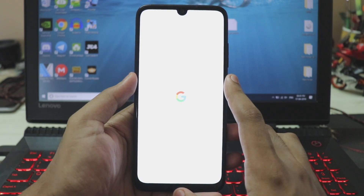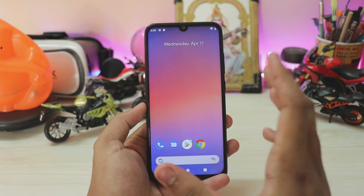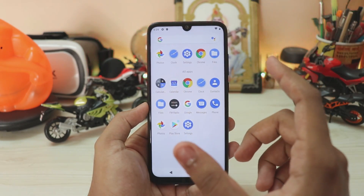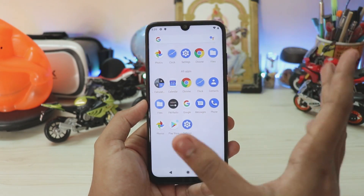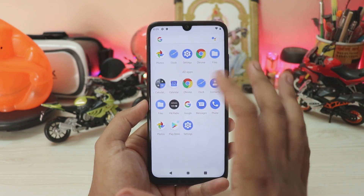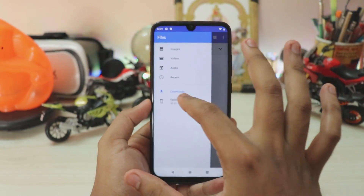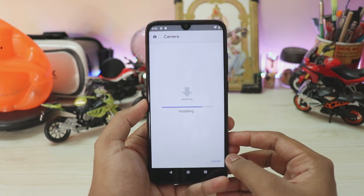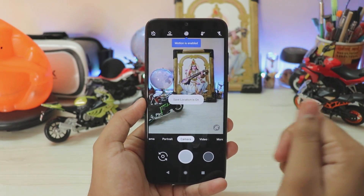The ROM has been successfully flashed with no errors. Select reboot system and there's the Google logo — the first boot will take a few minutes. I've quickly done the setup since brightness doesn't work during it. On the home screen, you won't have a camera app yet — just a Snapdragon camera app the developer added — because the GCam isn't finalized yet; we're still using the Nokia 7 Plus port. To install it, go to My Files, find the GCam 6.1 file, and install it.